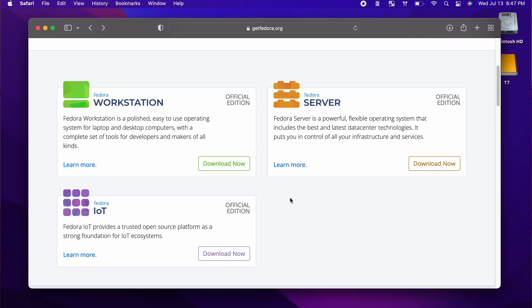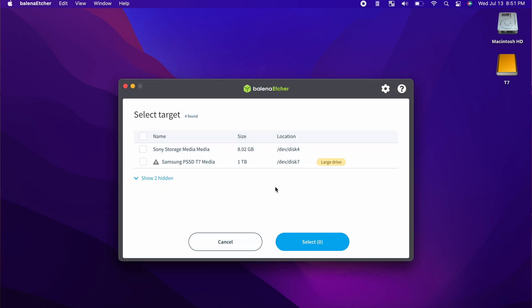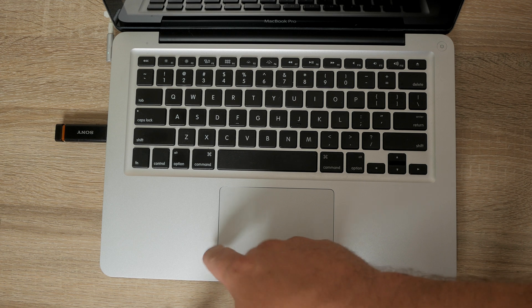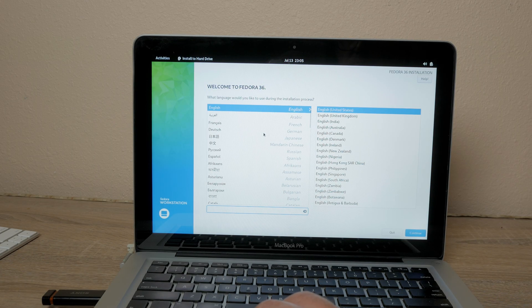Although I'm not going to do the tutorial in this video, to get these installed for pretty much any distribution is super easy. You go out to the site that provides that distribution, you get the ISO file, you use something like Etcher to burn that onto a USB thumb drive — and you can do that from Linux, Windows, or Mac OS. Once that's burned on there, you just boot your computer with that USB in there and hold down the option key. It'll give you the option to boot into the installer, and from there it's just like installing it on any other computer.